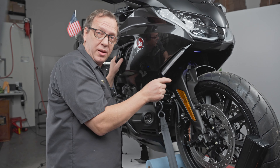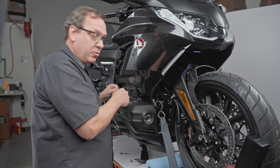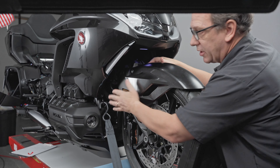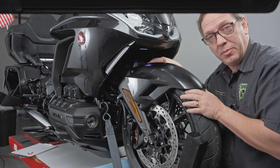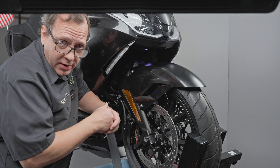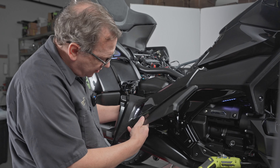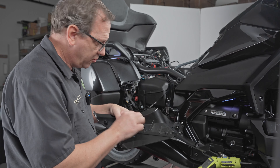Now's a good time to reinstall the side cover and trim panel, then put the front fender on, plug it in, and make sure those are all working. Button up the rest of the wires, tie up any loose ends, and see what we've got. I've plugged in the LEDs on both sides of the fender and am now reinstalling the fender. Once that's in, double-check that the wiring is still clear. Get it down on the ground, turn the wheel, and make sure there's nothing binding before you go for a ride. The only thing left is to install the last LED on the side cover by the seat, button everything up, put the seat on, and go for a ride. Just like we did on the other side, get our LED to go inside here by removing these three screws and stick it down.